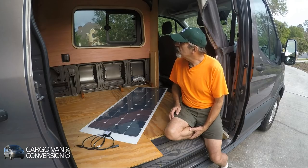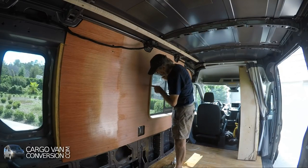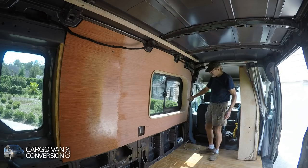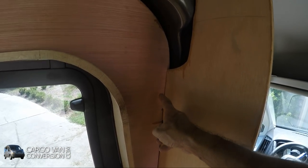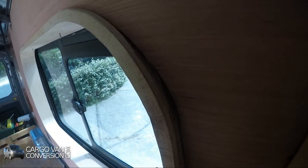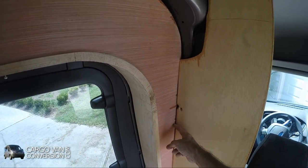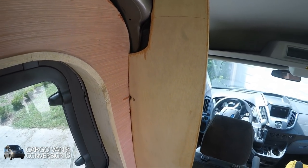In the meantime, I worked on the window frame and finished what was still left. That works out beautifully. I see that the wall panel just bows in a little bit, so I have to make sure that's attached — that's still an open question. Now with the side panel in place just behind the driver's seat, what happens is that the wall panel is pressed towards the side, and that opens up an area here behind the window frame. So what I'll do is cut along the panel so it will come in, and put a strip on the panel so it'll be flat to the window frame.